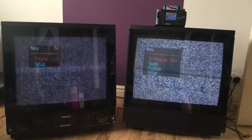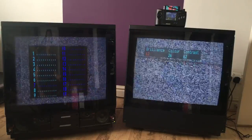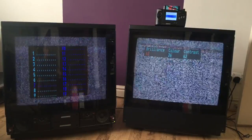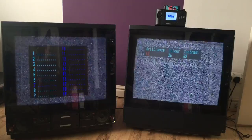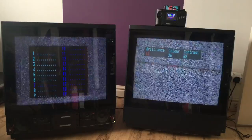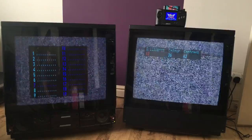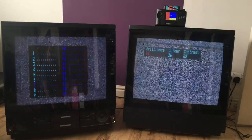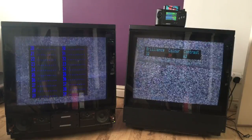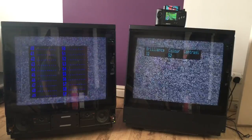So if you go back into TV and press Menu, you can see the difference. Go down to Picture. The one on the left — I can't get into some of these settings because it's such an old software version; I'd have to bridge two wires at the back to get into service mode. But I've got all the settings I need. I'm going to set it to what my MX-4000s are set up. Brilliance on this is 62 — I've actually got 32, so I'll knock that down to 32. Straight away you can see the colour changing. That goes from that to 52, and then contrast 61.